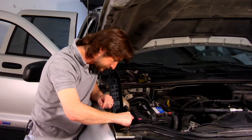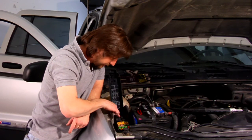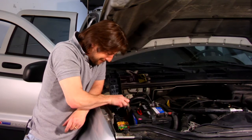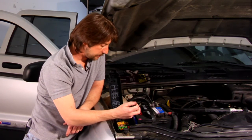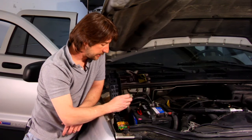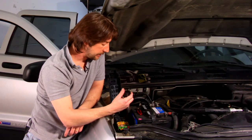But if your fuse is okay, stick that back in. Locate your relay. These should have power to them at all times. If you had a test light you could check down here. But chances are nine times out of ten your problem is going to be with your relay.